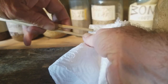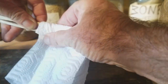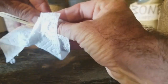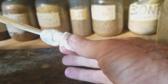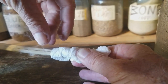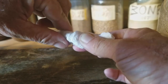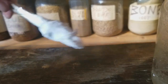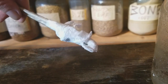And then from there, I just opened it up like that, put it inside here, wrapped it, and then basically wrapped around, gave it a fold, and then just twisted it up like so, right? And then I took a piece of tape and basically just taped this thing on here. All right. And so it gives me something that is like a scrub brush that I can go in and wash all that corrosion off the inside of the tank.